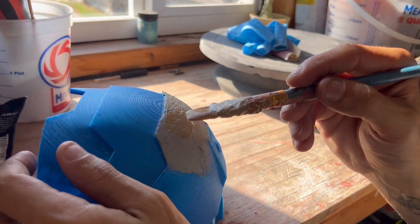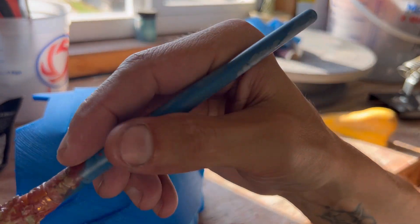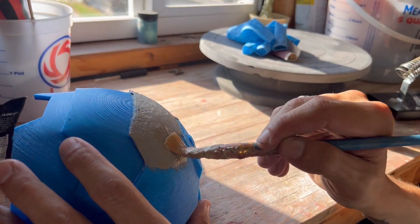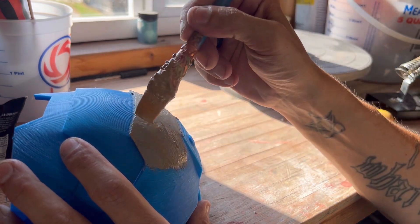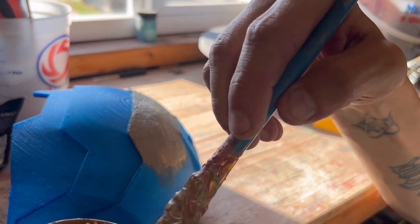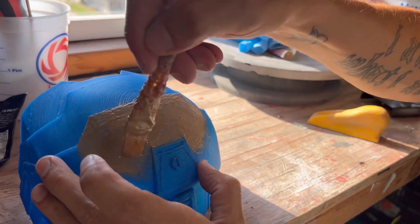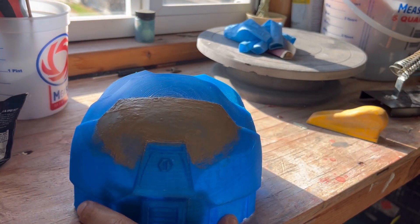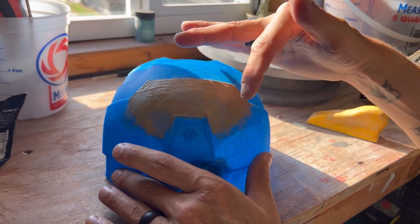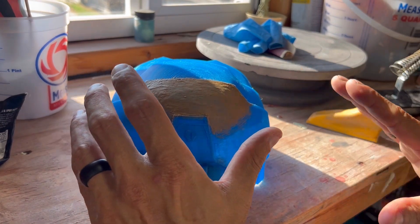What I like to do is put a little bit of acetone in a dish. The beauty of using this plastic metal is it can be reactivated with acetone within a certain window — you can reactivate it and actually smooth it out, thinning it down in a sense, but not making it too thin to where it won't fill in those gaps. This is a neat trick because it does cut down on sanding. With body filler if you don't get it completely smooth those high spots are a pain to knock down, so by introducing acetone it thins it down and smooths it out, making it nicer and quicker to sand. I'll sit this in the sun for about two to three minutes. If you're afraid of using acetone, just put the plastic metal on with your finger and give it 15-20 minutes to dry — with the acetone method it'll be ready in about five minutes.